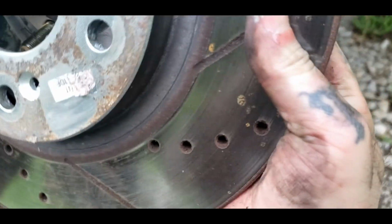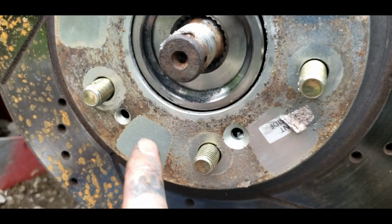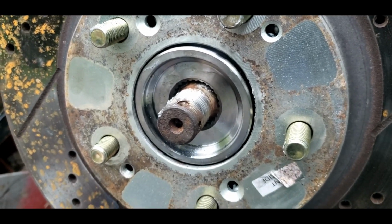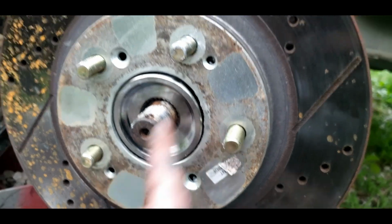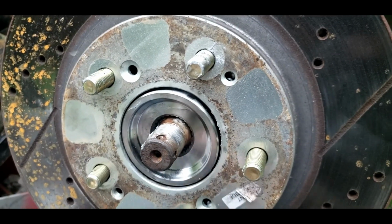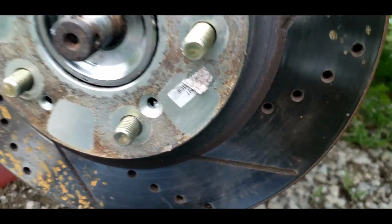So go ahead and set your rotor back in place. I might add, if you do have the bolt in on the factory rotors, I do got a video, I'm pretty sure, on me changing these rotors from the factory. It's in my channel. If you don't see it, leave a comment and I'll show you how I changed these rotors. I'm pretty sure I got these out by drilling them on the factory rotors, because I couldn't unscrew them. So once you get that, next step, we'll put your bracket back on, same way it came off.